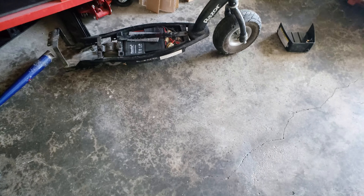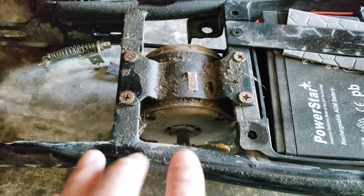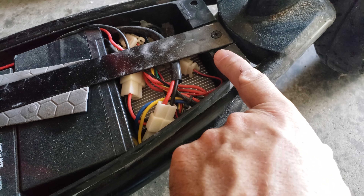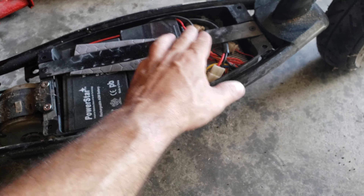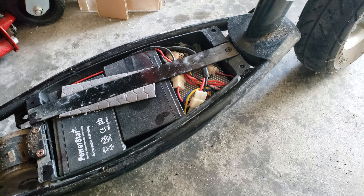What I started with is one just like this — that one's blue, this is a black one, an E300 Razor. The kids kind of outgrew them. You can see right here where the motor mounts are. Up here there's a plate underneath this plastic box, and then there's this plate right here. Those are the two plates I stuck together and welded across top and bottom, then put a couple supports in there.